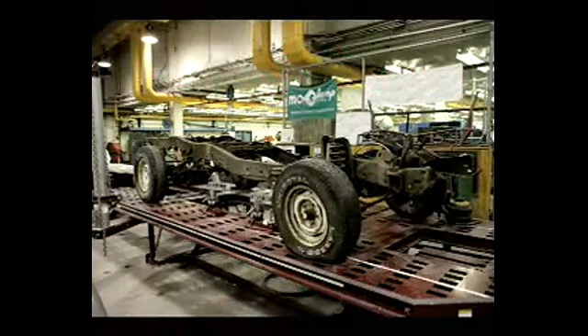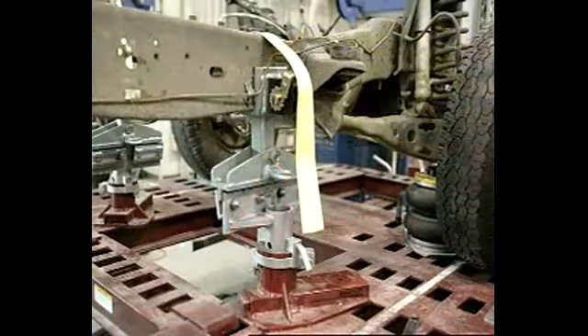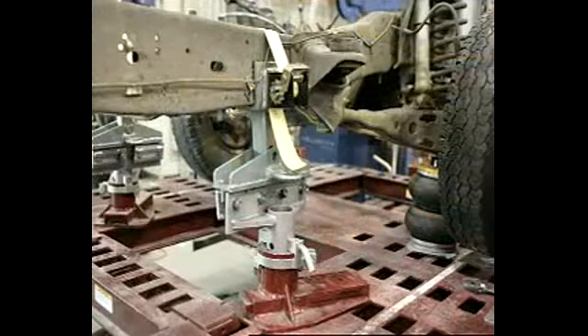Let's watch the actual procedure now as we set up a Ford half-ton frame. First, place an air jack or similar lifting device under the rear differential and jack the vehicle up until there is sufficient clearance to put the stands on the vehicle and into the pinch weld clamps. Place the yellow short strap over the top of the frame rail in the approximate position you wish to use for securing the frame. Position the top leg of the stand so you can attach the strap and begin to winch it up. Lower the MoClamp stands into the pinch weld clamps and do your final adjustments to place the stands as far back as you can and maintain a proper datum for your measuring system.